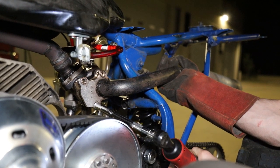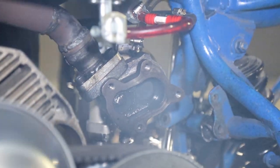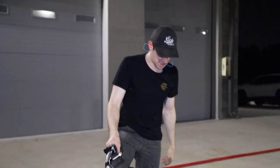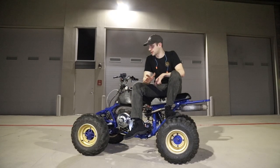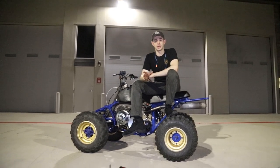Moment of truth — it's still there, but there's definitely end play. We'll see what's going on and check if it's spinning nicely. It is spinning, but I did hear weird noises still. Maybe $150 turbos aren't the best — it's got some slop in there, that's for sure. We checked everything over and it seems okay — the engine is totally fine and all the drivetrain is fine, no problems there. But the turbo does have a little bit more play in the shaft, so we're thinking it might be worn out or we may have cooked the bearings.